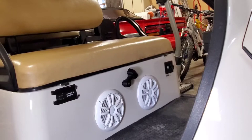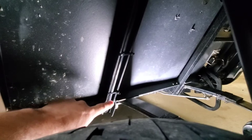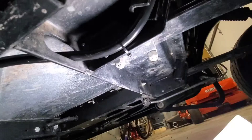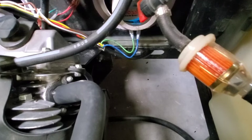There are the speakers — just some 6.5-inch marine-grade Boss Audio speakers. For this portion I'm going to have to do a handheld, so it's probably going to be moving around a little bit. You can see I tucked the 7-conductor 14-gauge wire in this channel all the way up and then inside the dash. Here's the antenna wire. This is on the bottom of the cart — it comes out of the channel, and I just ran it through these factory holes up into the engine compartment.